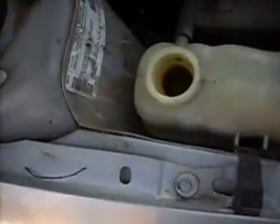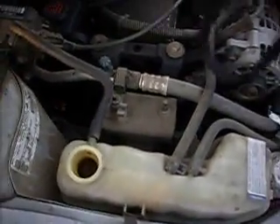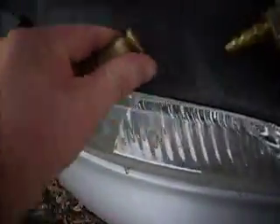We've definitely got a blown head gasket — cylinder leakage on cylinder two. Cylinder one also sounded like it was leaking pretty substantially, but I wasn't getting anything out of the coolant system, making me think the rings may already be damaged on this engine.